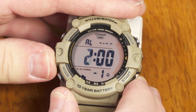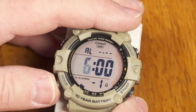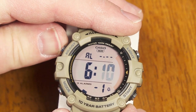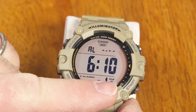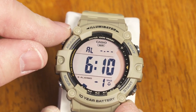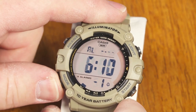The first alarm has the option of being either a standard alarm or a snooze alarm that repeats every five minutes for up to half an hour after the initial setting. One thing that's sometimes frustrating is that when you're doing the settings, you can only advance — not reverse. That's not so bad with the hours, but if you're trying to advance minutes and you go one too many, you have to go all the way around again. You can tap the adjust button to activate the snooze feature or turn off the alarm. If an alarm is active, it keeps a little reminder on your timekeeping screen telling you that alarm is set to go.